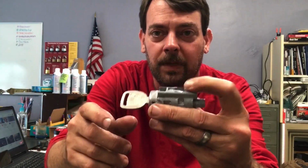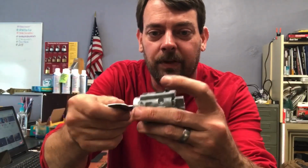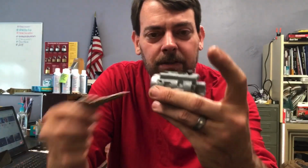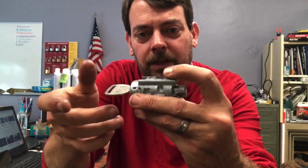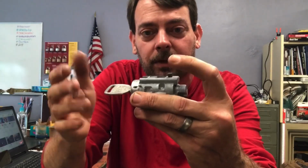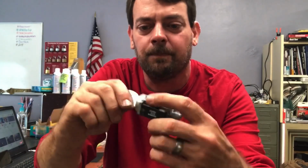When you turn your key, you're able to push this in at a certain position. You have to have the key to get this out. A lot of people think that you can just pull the ignition out. However, with no key in it, the retainer won't go down. You got to turn the key to accessory or run, depending on the car, to get that to go down, so that you can slip it into the plastic housing. Anyway, there we go. GM10 cut ignition.